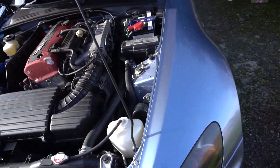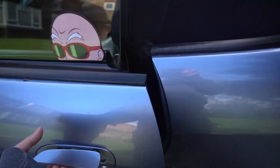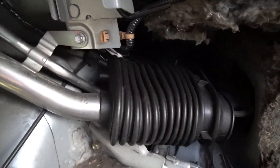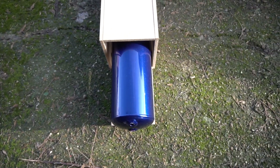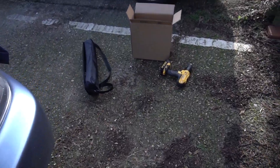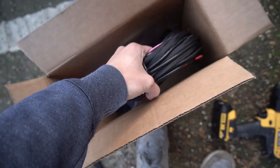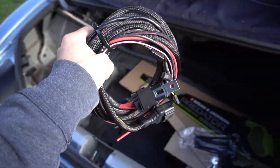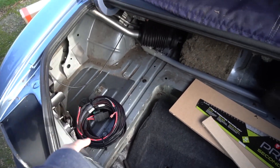I've made a head start. I'm having a look at where I'm going to be running the line — the battery's here and there's a rubber grommet underneath. I need to remove the passenger seat, remove all the trimmings, and I think I can run it straight through to the back. There's an access hole right at the back there. This is San Marino Blue with some extra sparkle in the clear coat, by the way. So the harness is inside this box — this is the airline and this is the main harness with the relays, fuses, and everything I need. The main objective today is to get power, power up the compressor, and power up the remote controller.